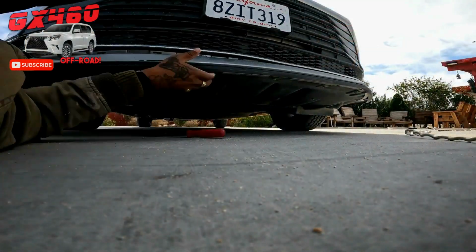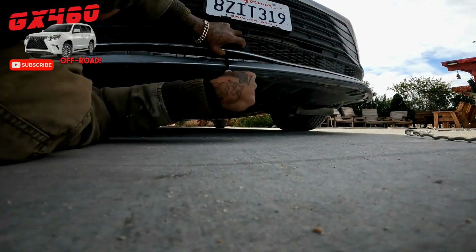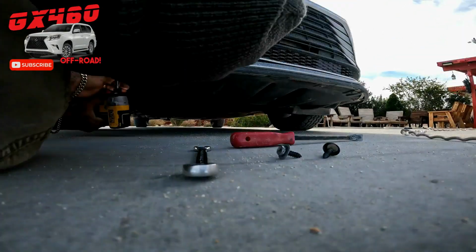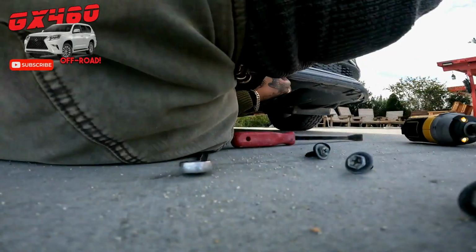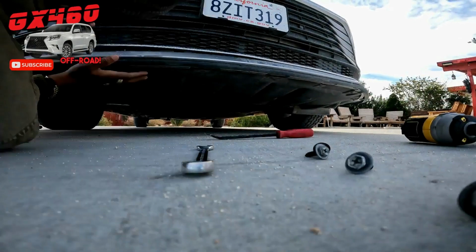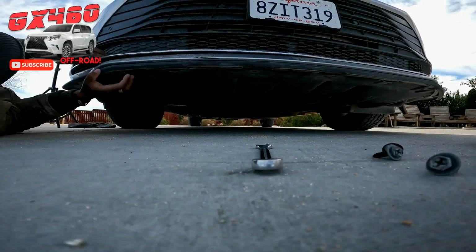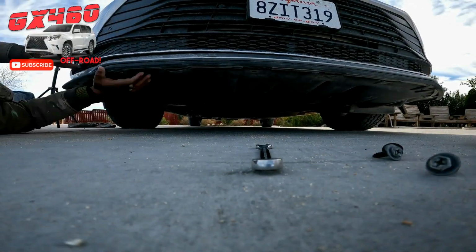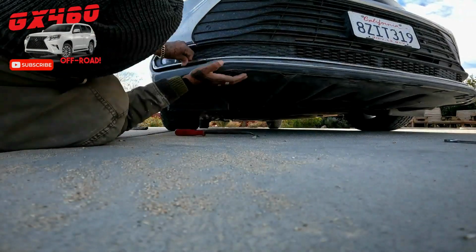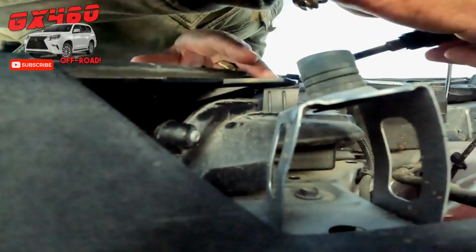All right, down here to the fender, we got basically the same idea. All these body parts today on modern vehicles are plastic clips and stuff, and when you break them, they all break and shatter all over the place. So you got to do what you got to do. This needed, excuse me, a bit of prying and coercion, as you can see, but just take your time, work things around, get what you can get back to be clipped, and forget about the rest.